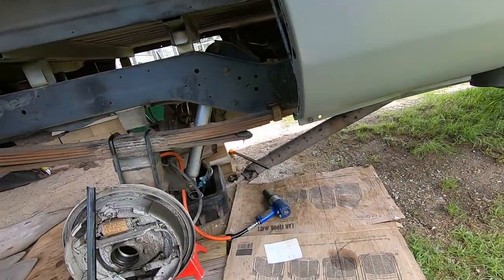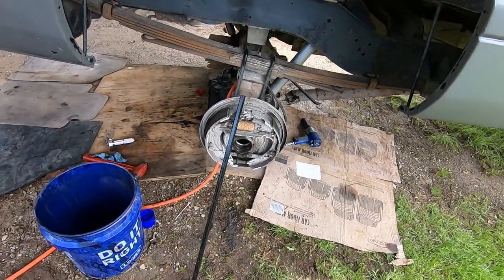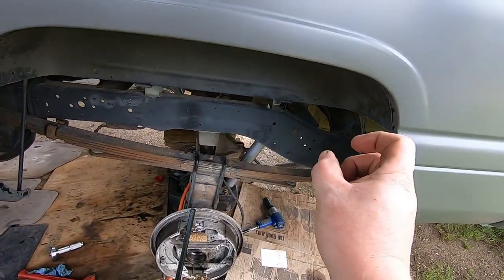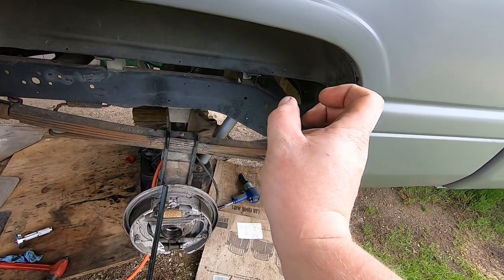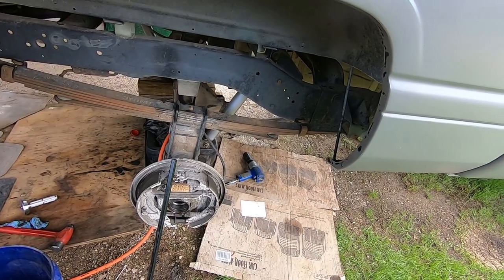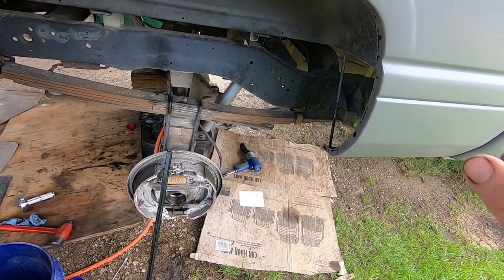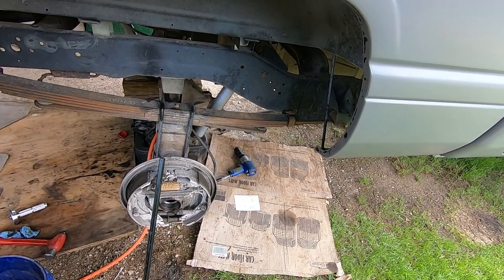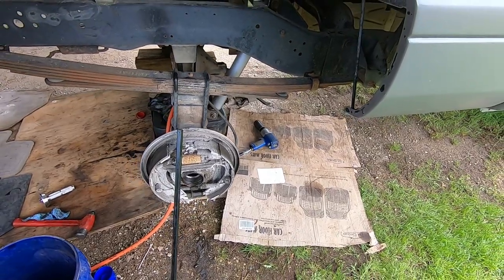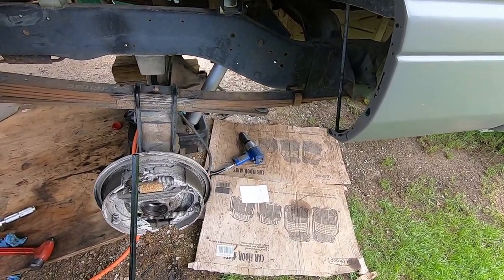In my big pry bar, and then you jack up the jack and it'll tighten it up. So once you have the lash at zero, that means that the crush sleeve has crushed just a little bit. That's all you need. The rest is much easier. Once you get to initially crush, then you can put your seal in. So that's what we're gonna work on. We're gonna put the seal in first, put the flange back on, put the new nut on, tighten it up.